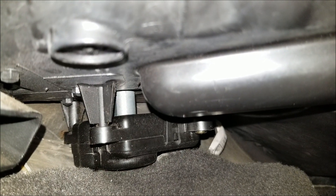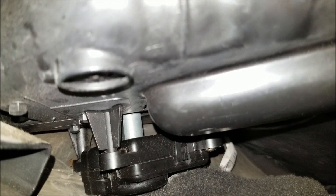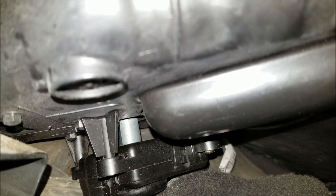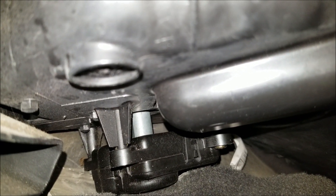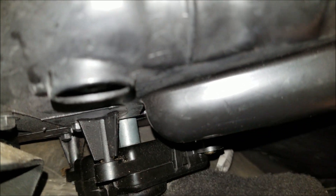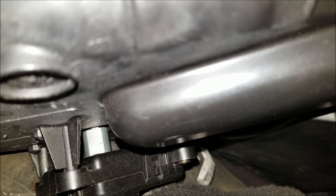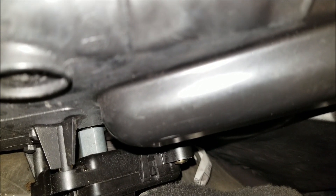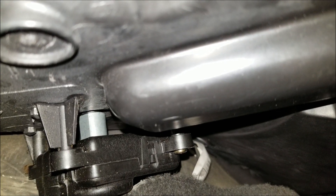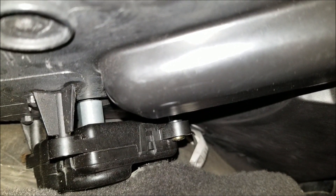I know I just signed off, but I wanted to give you one last shot of the repair in action. I just confirmed that the actuator and blend door motor is working correctly now. You can see it in action — that's the shaft right there that turns the blend door. If you adjust the controls on the dash, you will see it rotate slowly. That's a good sign and a good way to test it after you're done. Success! Once again, thanks for watching — I hope this has been helpful.